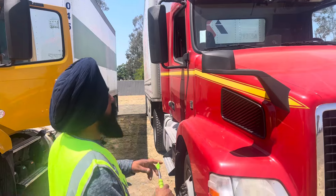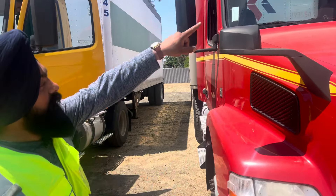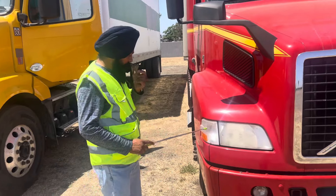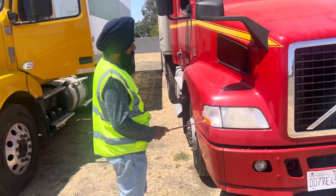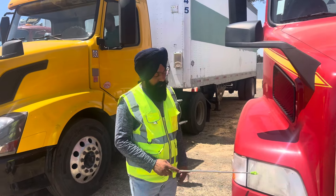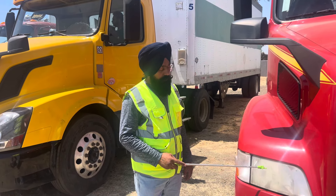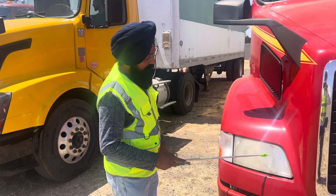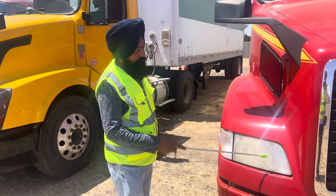Front of the vehicle: five clearance lights, turn signals, four-way flasher — amber in the front, red in the back. Headlight securely mounted, not cracked, not broken, always clean, no illegal stickers. Both headlights securely mounted.